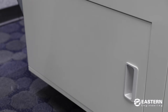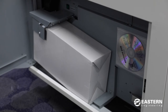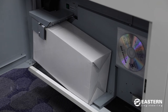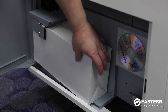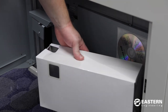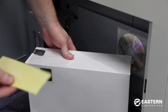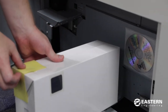If you look inside the left-hand side door, you'll see this is where the waste box is located. Eventually this box will get full and it will prompt you to replace it with a new one. When you go to remove the old waste box, pull up on the right side of it and that will release it from the slot, then slide it to the right to remove it. Inside the new waste box package there's an extra piece of tape that you can use to seal up the hole so toner can't escape the box.